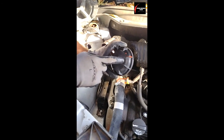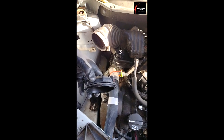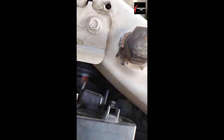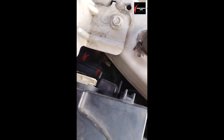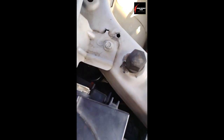There's a cover right here that I've already taken off. If you look here there's an arrow and it shows lock — this way to tighten, this way to loosen. Straight down through that access hole we got through the little plastic up under the fender, you'll see this little cover here. The light bulb is under here. I found it easy to push on this little bar here if you need to, but it's got little grips on it so you can just kind of grab it.